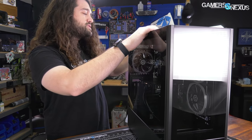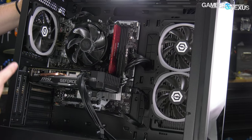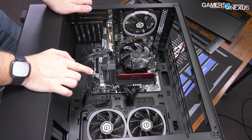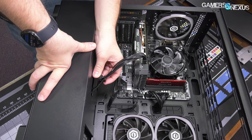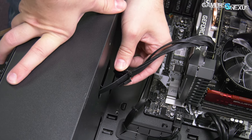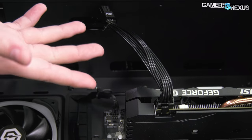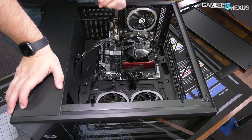Okay, so let's get into the teardown. This is much more standard than the Dell system. Some really obvious things I see immediately: it's a downdraft cooler that's loose, which tells me there's probably a mounting problem — we're going to look into that. The next thing I'm noticing is actually a positive: CyberPower has done really well with cable management. It's actually extremely well done. There's only a couple things I would change — small attention-to-detail stuff. They've got this extra 8-pin PCIe header that's a daisy chain off the power supply zip-tied down here, and they've hidden as much of it as they can. This is still really good. It's a much better starting point than some of the other pre-builds.